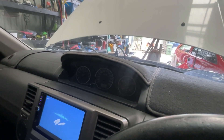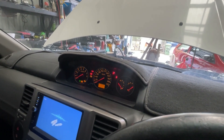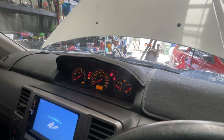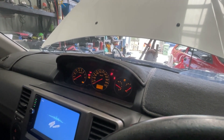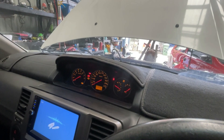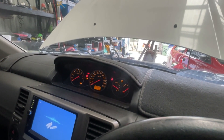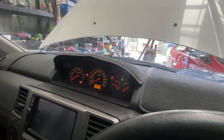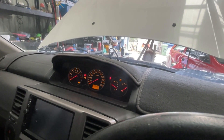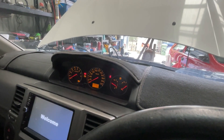Let's put the lights on so you can see a bit better inside the cabin. We've got the engine light, the battery light, and the oil light. They don't all always stay on — a lot of things just go through a check and then go off. Let's wind it over and see what happens with that oil light. With the oil light going off while it's cranking, I'm now super happy to put the coils back in and start this up.